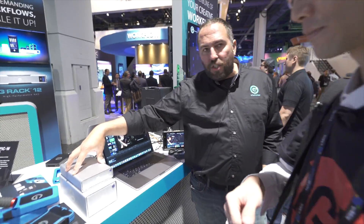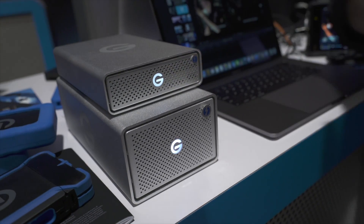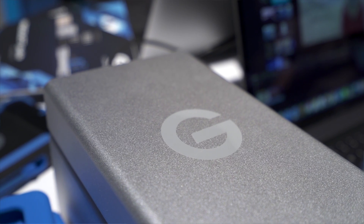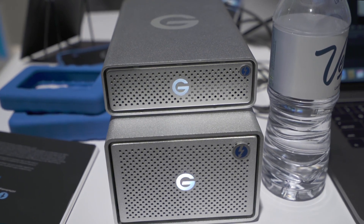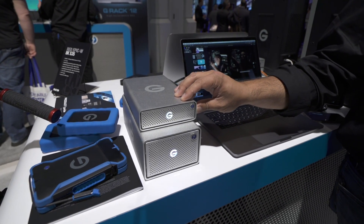What we're showing you today is the G Drive Thunderbolt 3. We've also got a G RAID with Thunderbolt 3. These are beautiful all-aluminum drives with a five-year warranty and enterprise-class 7200 RPM drives. These are awesome. The single disc will go up to 250 megabytes a second.